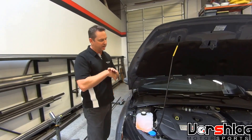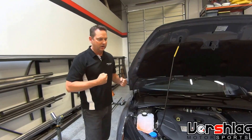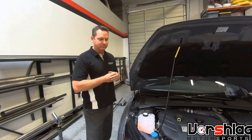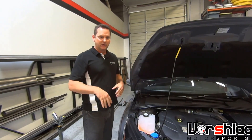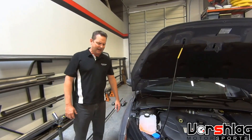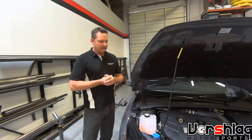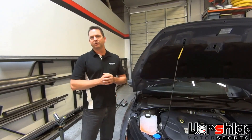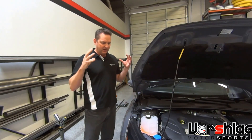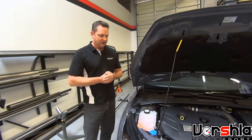So to do any camber adjustment — I don't care who makes it — there's no magic. It's a physical constraint; there's nowhere for the spring and strut to go. We can't do it with this spring or a lowering spring, so we're going to have to really push people to coilovers to get any camber — otherwise they're going to tear the tires up. This car had 1.1 degrees of negative camber, which wasn't bad, but it's not enough for track use. It's just going to shred the outer shoulders of the tires — possibly in a weekend you can go through a set of fronts. We really encourage people to think about tracking these cars knowing they're going to be camber limited. There is no factory adjustment.